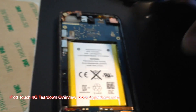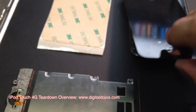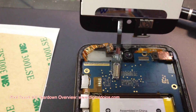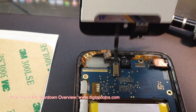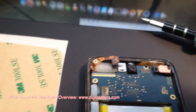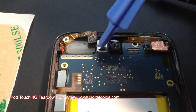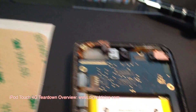Not too hard — the screen's already broken so it doesn't matter too much. You want to pry it up starting from the bottom. When you lift up, these two cables right here will be connected. This long one will be connected under where the motherboard is, while this other connector will be pushed down right here in that little slot. So you'll have one connector behind this metal thing and another one right here — that's your LCD and digitizer.